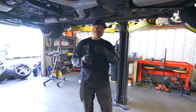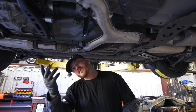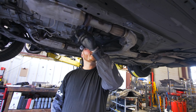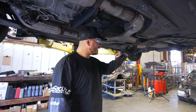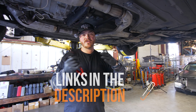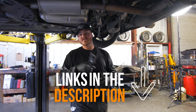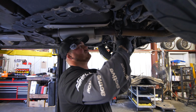And then if you were to do a Y pipe, like an ISR Y pipe, we're not doing one because this one's good. You literally would just take two 14s right here, two 14s, and you already have this one undone if you're doing the rear exhaust, and then this just comes right out and you put the new one right in. And we do stock those, by the way. I don't know if I said that, but we do stock those.